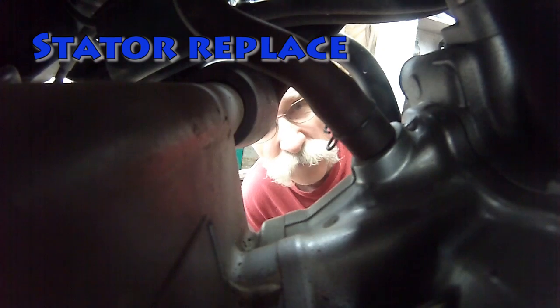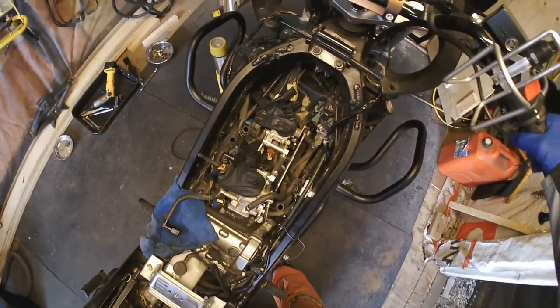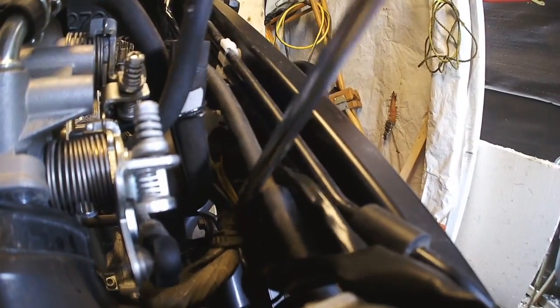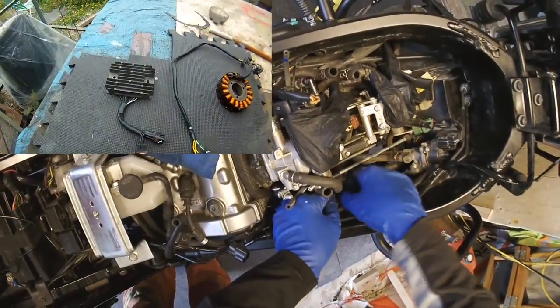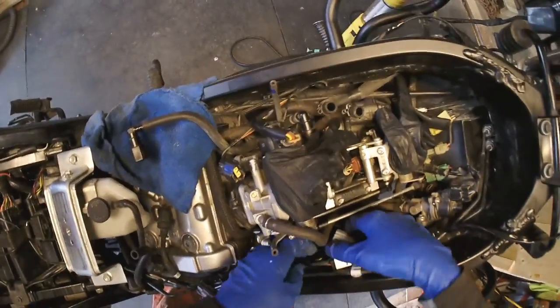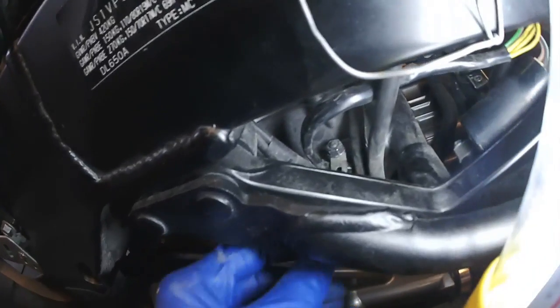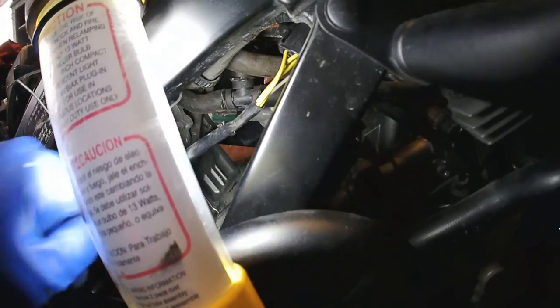Okay, let's get on with this. When we last saw the DL650, we were looking over the side at the plugs to the stator and the rectifier. I'm gonna have to cut that plastic clip — it'll free up that triple pack. The stator wire splits into two and sits just below the two wires that come from the rectifier. There we are — stator unplugged. There's also a Suzuki strap clip in here, and we'll weave the wire out from there.